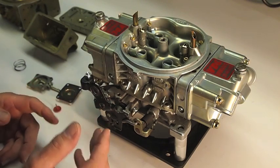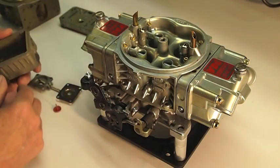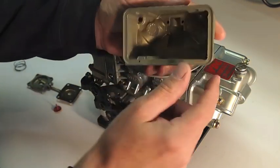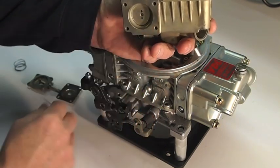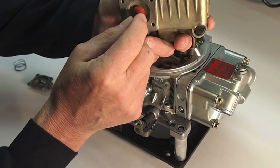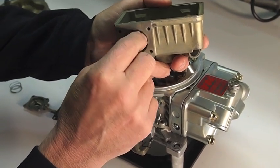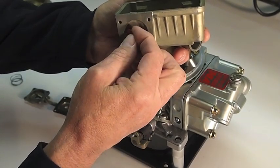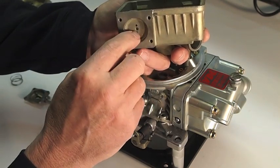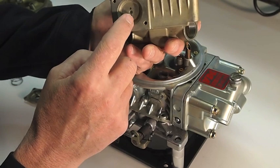The first thing we're going to do is talk about the fuel circuit — the fuel passage for the pump nozzle — so that we understand all the different areas we need to look at in diagnosing this problem. Fuel comes in through the fuel inlet of the fuel bowl, into the fuel bowl, and then gets into the pump housing area as it goes past this umbrella seal here. The umbrella check valve needs to be of good integrity. You need to look at it and make sure it's not deteriorated. If it is deteriorated, it won't reseal when the fuel is pushed back up when you activate the pump arm.